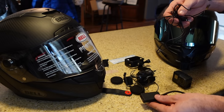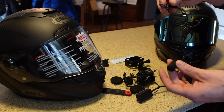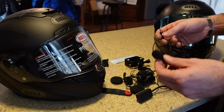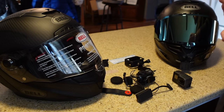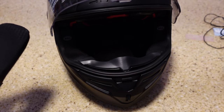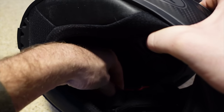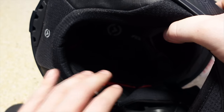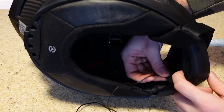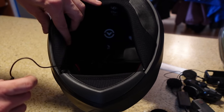In addition to this microphone adapter, you're of course going to need a microphone. This is a 3.5 millimeter Giant Squid microphone. It's way longer than what you'd ever need for inside a helmet — it's made for a lapel mic, something you put on your t-shirt to record yourself talking or a phone conversation. I'll go ahead and link that down in the description. I'll start off with installing that first. We're going to remove the cheek pads on the new Bell Race Star helmet and put those to the side. Come into the inside of the helmet — you see these styrofoam little plugs. Go ahead and take those out; they're for your music or microphone, just gives you that extra little room. I'm going to go ahead and start installing the microphone for the GoPro in the helmet — we'll just slide that up front there. We're always going to run the microphone for the GoPro at least on the right side, where our cable exits on the left side, your clutch side.